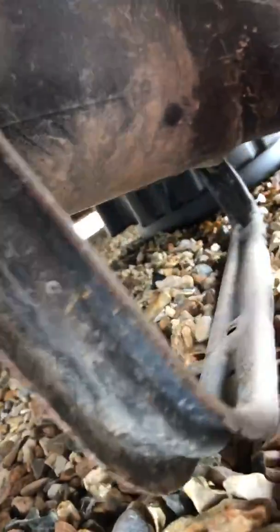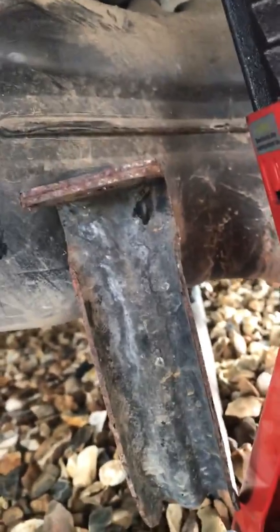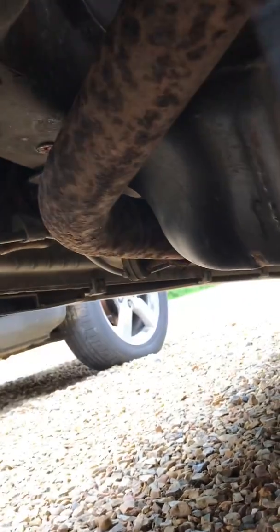And there's only 4 bolts. So here's the bracket, and you've got one on one side, one on the other side. So 13mm bolts. Now what I did was stick a jack underneath this side, so to the right hand side, so driver's side of the car. If you're in America, the passenger side of the car. And I took off the shorter bracket, you see my finger, from this side. Now the exhaust system does hold the tank up over that side, which was quite handy.